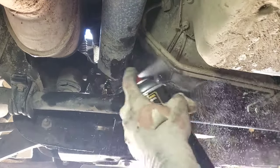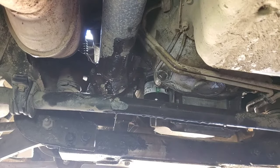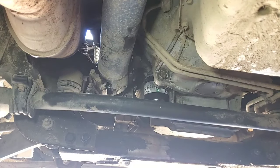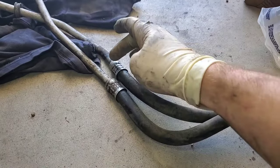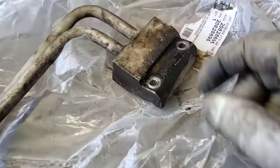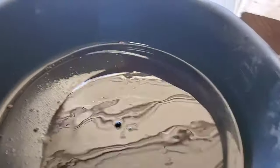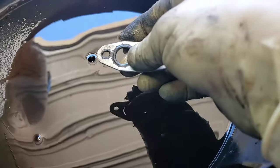Use your brake cleaner to clean up all that gunk from where it was leaking — you really can't use too much of this stuff. Grab your paper towel or washcloth or old t-shirt and wipe her on down, and it's looking pretty good. Let me show you these old lines — you can cut the lines back here on both sides and put a new rubber hose with some clamps. I mean, why? Just replace the whole line. But if you don't have the 80 bucks this line cost, then you could do it that way — it'd probably get you down the road. Unless your block's leaking, that would be a problem. This grommet on the block actually looked okay — I'm not real sure why it was leaking. Maybe it just came loose, or maybe the rubber just got dry.